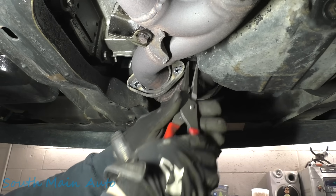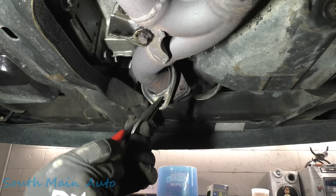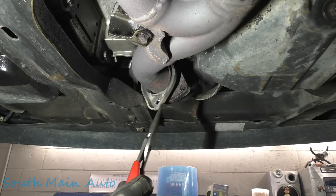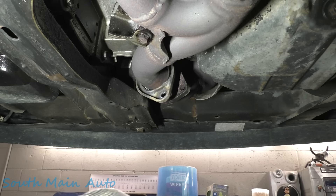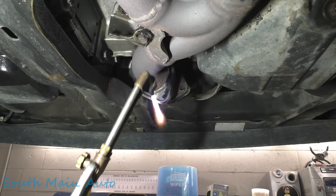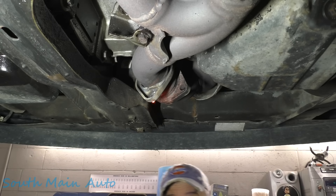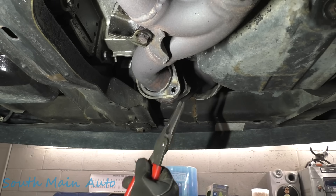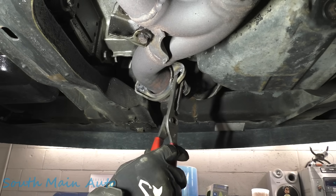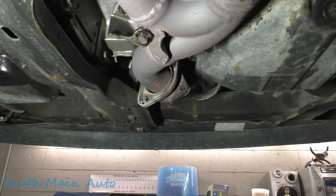Let's go around and look at this one. Usually what they've got, folks, is just a couple little tack welds in the corners of the nut, and you just take the torch and nick them a little bit, then tap them with the air hammer and they usually come right off. These ones are playing hard to get. Being on a flange like this, you typically take the torch and burn the sides of the nut a little bit - that breaks the bond.